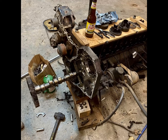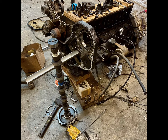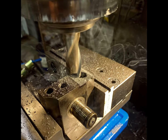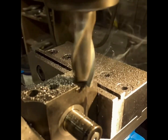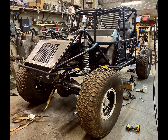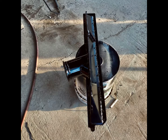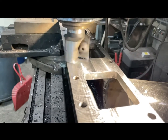Now for some engine work. Got a new camshaft, larger tappets, and head studs which required me to mill down the rocker arm assembly. The Cummins engine has the intake cast right onto the side of the head — I had that machined off and fabricated a new intake to replace it. I had to surface it in the milling machine so that it would seal properly. Here it is with the intake and silicone tubing installed.